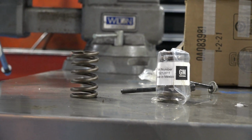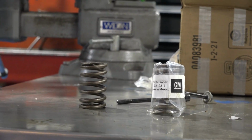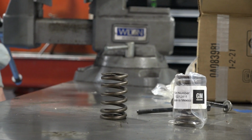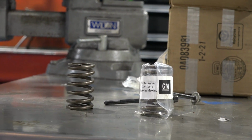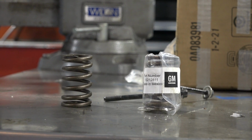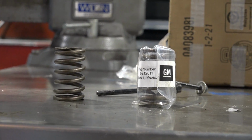One of the big things is we heard about people who got in trouble for valve springs. Did they just use the wrong part number, or are there aftermarket companies that make these? Well, if you know what you're getting and you plan on getting what you're supposed to, there should be no misconceptions. But there are other springs out there on the market that you can get, and some people have chosen to run them. They run you a little bit more money, and some really aren't even a performance advantage, they're more just for longevity. But the rule book still states that we must run a GM spec valve spring, so that is what we are mandatory to run. So when the tech guy opens it up and sees that it is not the GM valve spring, then... And you said it's visible?